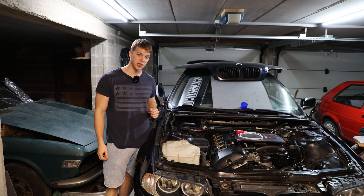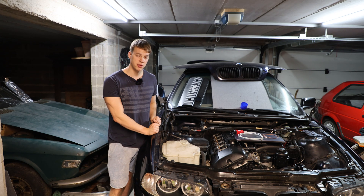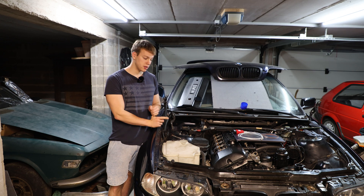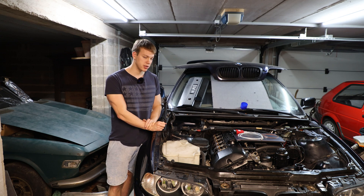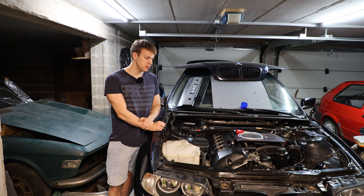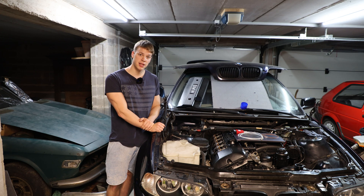In case you haven't followed this project on my channel — we need to flash the ECU because we swapped in an M52 B28 TU and this car was originally M54 B22 powered. So we have an M52 in the car that is usually run on an MS42 ECU, but I kept all the gear from the MS43 ECU — the throttle body, intake, everything — and that's why we need an MS43 version for this ECU. Thanks to the MS4X Wiki, we have a custom-made definition file for this exact setup.